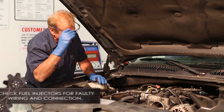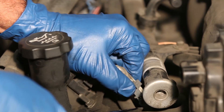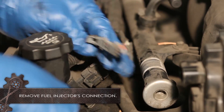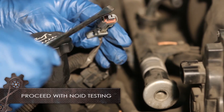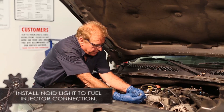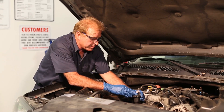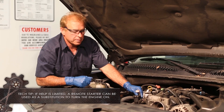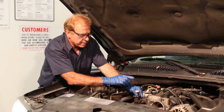So let's go ahead and bleed this off and we're going to check our injector itself. We're going to check our wiring at the injector. We're going to simply pull up on our tab, push in the tab, and pull up on our injector and take that off. Now what we're going to do is a NOID test — we're going to stick our light in here, crank it over, and make sure our light is blinking. We can install our NOID light and see if we have power going from the PCM. So we're going to go ahead and start our engine and make sure that this light is blinking. We have power from our PCM to our injector unit.